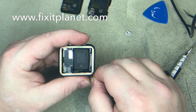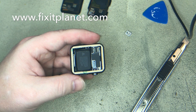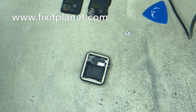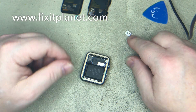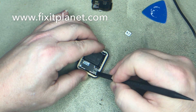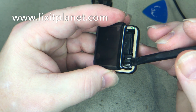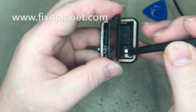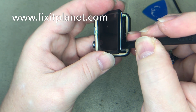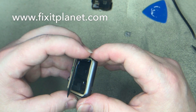That's another thing on iFixit — they show a razor knife to help get the gap started. I suppose if it's your watch and the screen's not actually damaged and you just want to get in there and look at it, that's probably an effective way of helping get a gap started. But you could also slip and cut yourself, or you could scratch up the metal. Not that it doesn't already have some nicks in it if it got dropped and cracked the screen, but still, you wouldn't want to do any more damage than is necessary. Here, what we're going to use is the spudger to put the pop connectors in place, because I can't get my fingers in there — the space is too small. And I want you to be able to see it on the video. Then I put my fingers in once they're snapped into place, and just make sure, double sure, that they're nice and firmly seated.